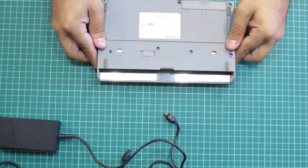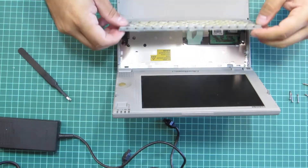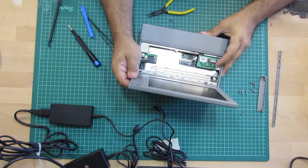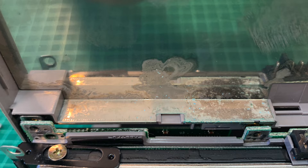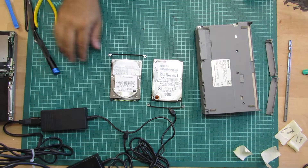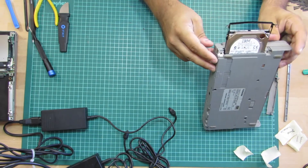It wouldn't be me if I weren't to start disassembling the machine to throw a look inside. Underneath the keyboard I find a heat shield that I'm going to remove. In the lower left-hand section there is also a connector for the CMOS battery. I would expect it to be dead, but when looking at the connector I spot corrosion. Also on the underside of the battery compartment I spot leftovers from acid leakage. I then also remove the hard drive on both machines. I realize they are two different makes — one by IBM and the other by Toshiba. My idea was to put the IBM drive, as it was the working one, into the still-assembled Libretto and try again.